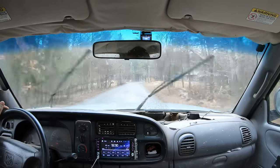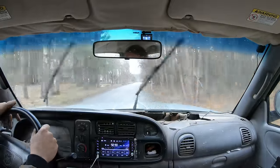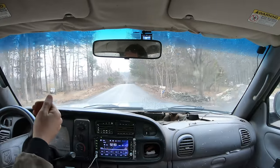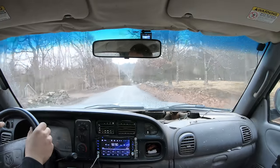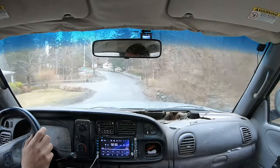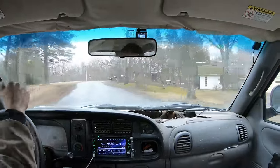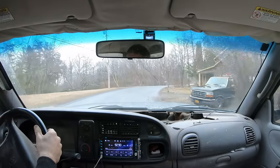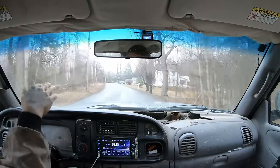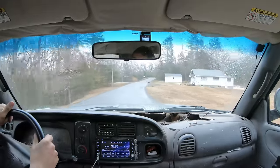It's important not to have too stiff of a spring, because the problem you'd have is taking a turn on a bumpy road: the back of the vehicle would skip out of control and bounce off the road. It would be like driving a Bronco too. The other problem is when you're empty, because that's a problem with dump trucks, they're so stiff that on a wet road around a turn, they'll just want to slide out. One time in my F800 when it was empty, I spun the thing right around on a slick road. When it's loaded, it's not a problem.